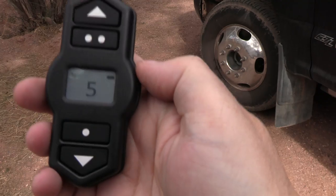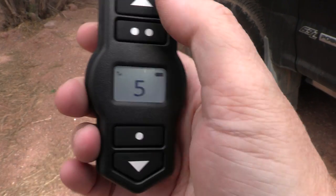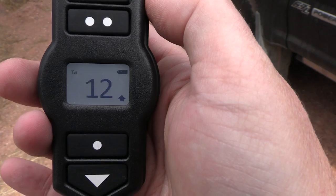Of course, when I take the camper off I have to put it back down to five, and you can do that manually or with a remote. Personally, I didn't want to be attaching a compressor to each individual airbag and pumping them up and down trying to figure out what PSI worked best for me. So we also installed a wireless one system. This remote actually changes the PSI in the airbags on the fly — you can do it while you're going down the road. Right now I don't have the camper on, so it's down at the minimum of five. I normally have it at 75 while I've got the camper on because it's so heavy. Do you hear that? That was the remote system pumping up the airbags.